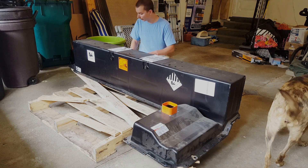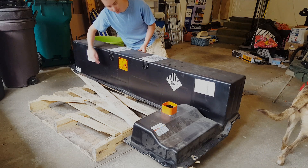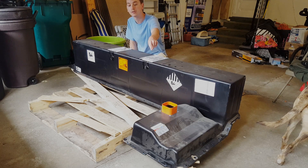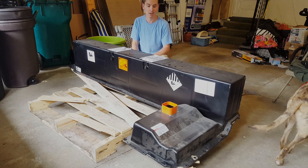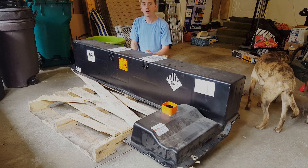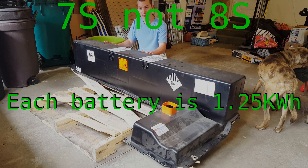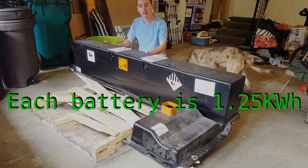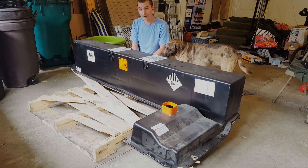There are no bolts that I can see on here. It looks like there were some bolts on here but all the nuts have been removed, so I'm pretty sure — other than maybe this connector in the front — this whole thing should just lift right off and clamshell open right up. There are 15 24-volt lithium iron phosphate batteries inside this. They're wired in series, so I'm going to pull this apart and we should be able to harvest some really good batteries from this module.